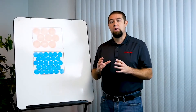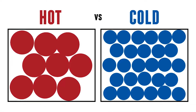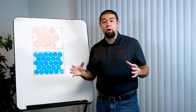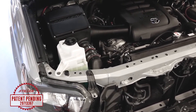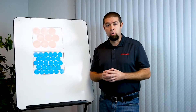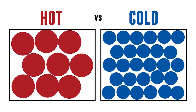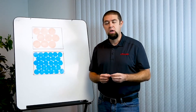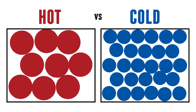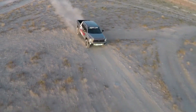I drew up a quick diagram to physically show you that a larger, hotter air molecule is going to take up more space inside the same box as a colder, more oxygen-rich air molecule. Your intake air box, intake tube, and throttle body are all a given size — that volume is not going to change. We can improve flow by adding extra ports or changing the shape slightly, but we're not going to change the volume of air we're dealing with. So our goal is to reduce that temperature — hence the term cold air intake. Cold air means air molecules are smaller and more dense, so we get that oxygen-rich, dense air into the engine for a better burn, which equals more power and more torque.